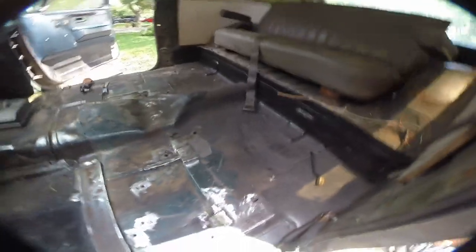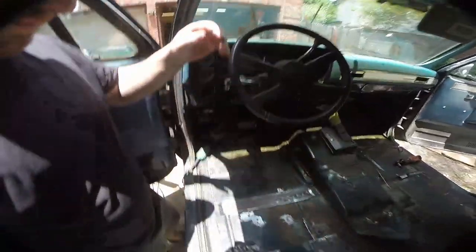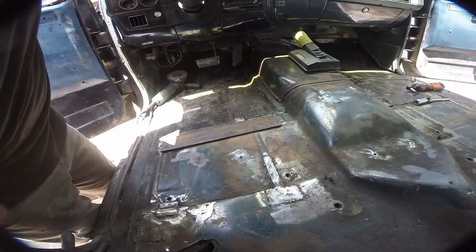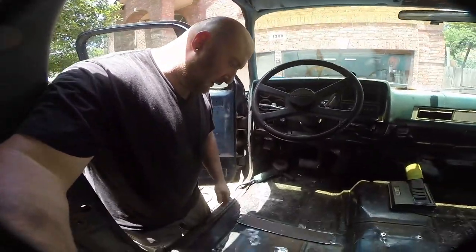These are bad cracks. Got it cleaned up. I left some of the speed holes in the floor — that way if we get into some water or garbage or whatever, it's not going to be too bad. Since I didn't want to add very much height, basically what we'll do is we cut this — it's maybe 3/16ths, maybe 1/4, something like that. Big piece of plate. We're going to weld this right here and then two smaller squares over here. We'll throw bolts to the floor and use some big washers on the other side. That way you basically have a really heavy, strong metal connection right at the floor — and it's not going to go anywhere.